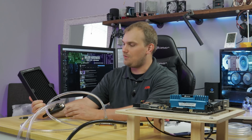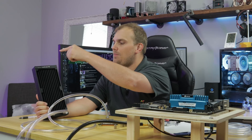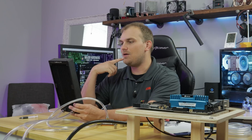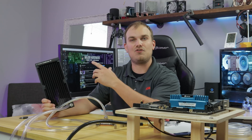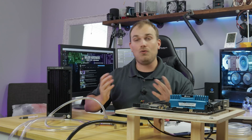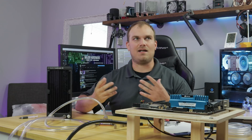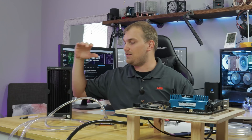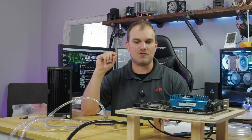You might be wondering why we have a radiator. Normally a radiator works like this: water goes in one side, goes up and around, and out the other side, and you blow air through it to cool down your water. Today we're going to do it backwards — put this in water, pump air through it, and try to cool the air going into the block as much as possible. It's kind of like a turbocharger hooked up to an intercooler — compressed air heats up, goes to the intercooler to cool down, then goes into the engine.